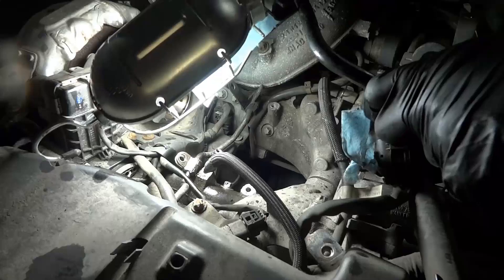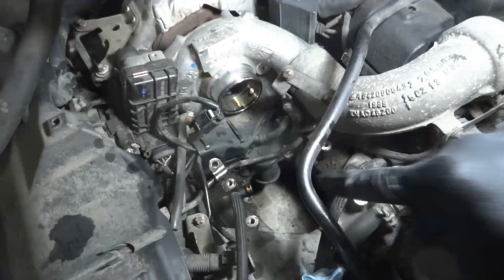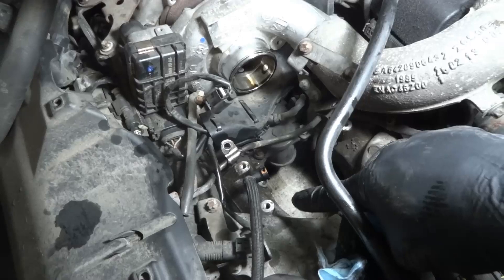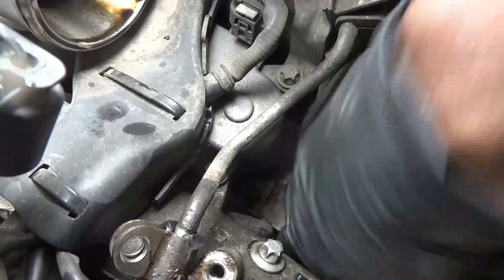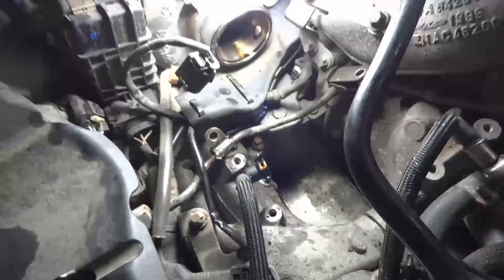We have a leak over here on our oil cooler. This over here is the oil cooler, and if we look around it you're going to see there is oil around it — the oil cooler gaskets are leaking. Let me touch around the oil cooler here. You see how my fingers are wet? So the oil cooler is leaking — that's where our oil leak is. The gaskets on the oil cooler are worn out. Now we're going to have to remove the turbo and the intake manifolds so we can get access to the oil cooler and replace it.